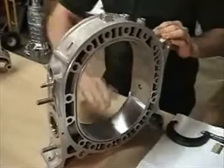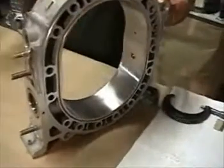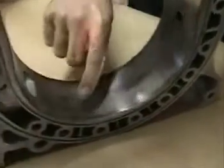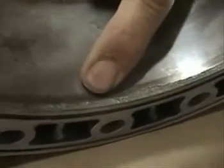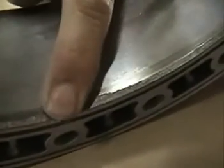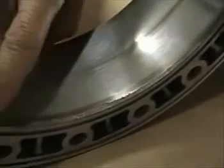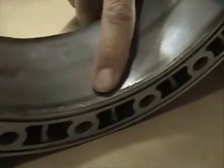The next thing I look at is the chrome surface. The most obvious and common failure — as in this housing right here — is where the chrome is actually pulling off of the metal substrate. You have a gap and of course there is no way for the apex seal to seal there. The factory specification is about three millimeters, but personally, any chrome flake at all in the housing in my opinion makes it not usable.